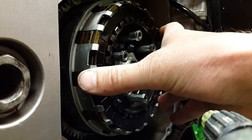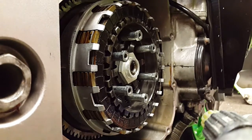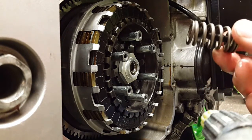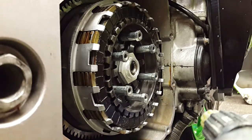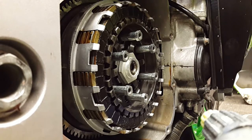So if you're going to tune the slipper clutch, just rotate them and put them in the same slots as the rest of the clutch, thereby eliminating the clutch slip. You also need to change the clutch springs from standard to uprated ones — these are EBC 10–15% uprated springs, so the clutch lever is a little harder, but it'll make the clutch work better. It won't slip under acceleration, but it will slip under deceleration.